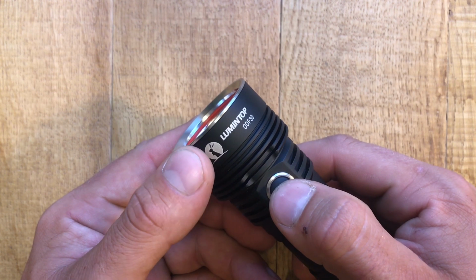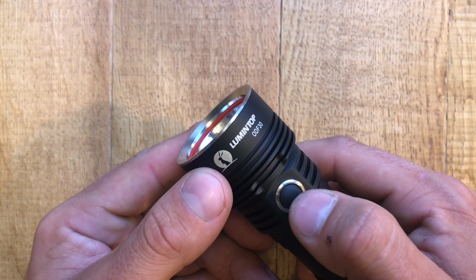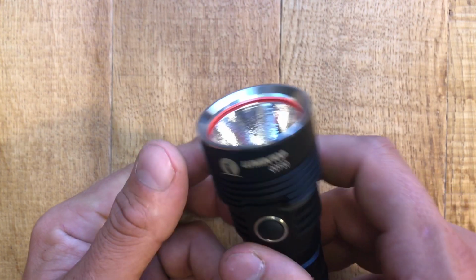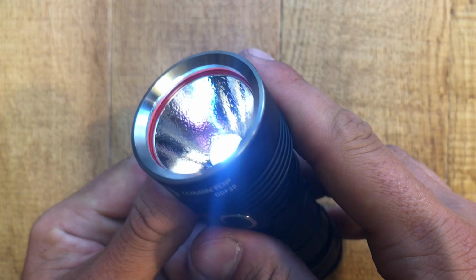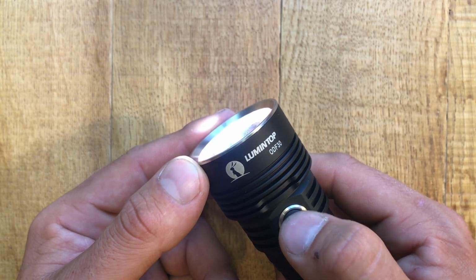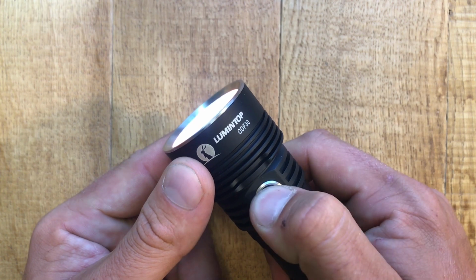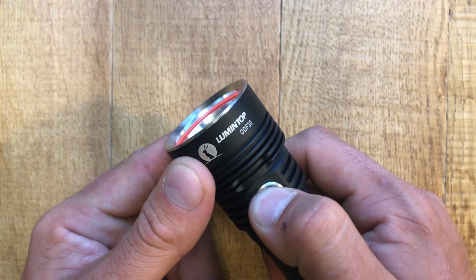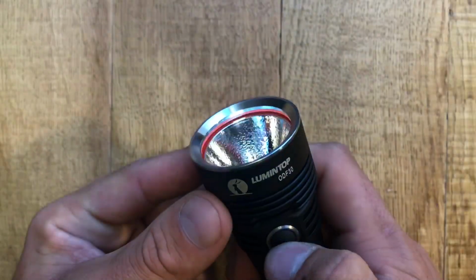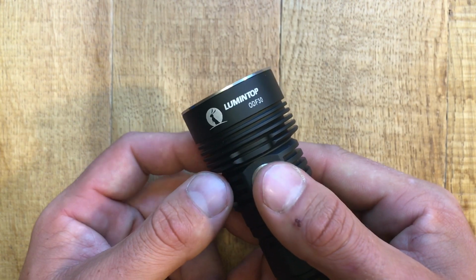The light also has an eco mode, which they indicate with 8 lumens. I think it's a bit less than 8 lumens. To get it you need to push down the button for about 2 seconds, then you can see the light ignites in the eco mode. From here you can go to the normal mode by pressing once. Then you go through the 3 regular modes again. But if you give it a double click from the eco mode, you go to strobe. So the strobe is well hidden, and I really like that because I don't need strobe.